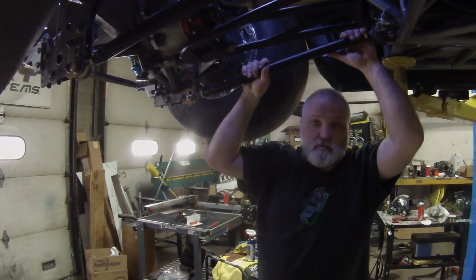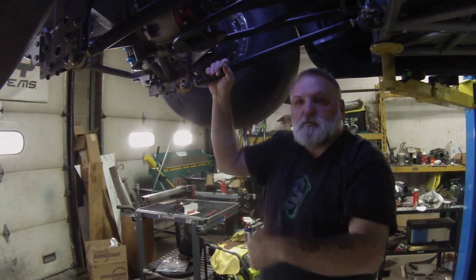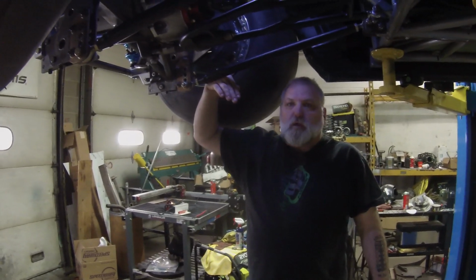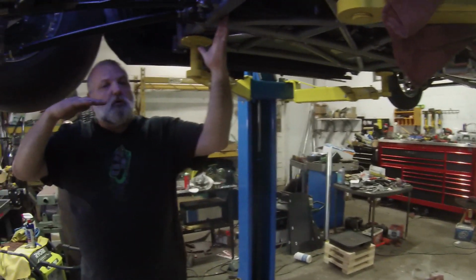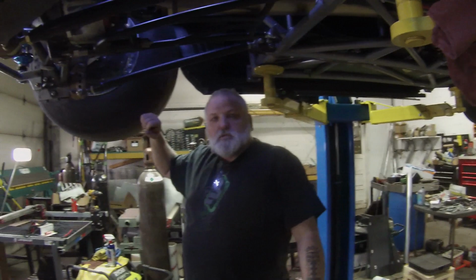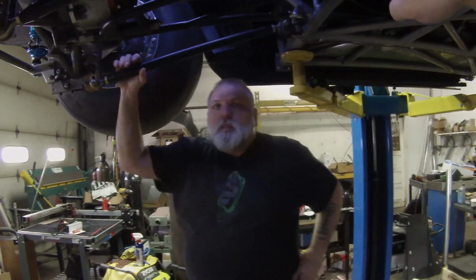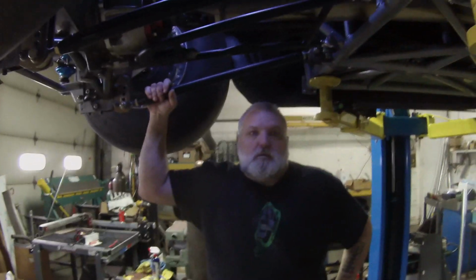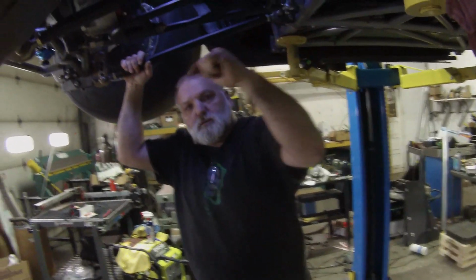Now, on a radial vehicle, completely different. You want this rear end to separate out of the vehicle. So we run an upward bar angle, which basically pushes the rear end underneath the car to a certain degree and puts the whole weight of the rear of the car onto these tires, driving the tires into the glue that's on the track. Okay, so since you're running this upward, when it hits, it's just starting to shove all of this that it's attached to up. Correct. And the tire down. Correct, which puts the weight of the vehicle onto the tires.